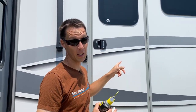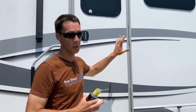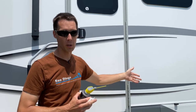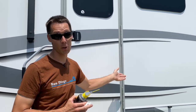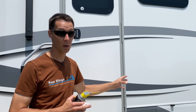Now let's take care of that annoying squeak. These are friction hinges on this RV. What these are supposed to do is stop the door at any point you open it up to, because there's not a latch in this door to hold it if you leave it open when it's windy. So you're not supposed to spray lube inside these because it's not gonna have a friction point anymore. But we leave the door closed all the time, so for us this works without a problem.